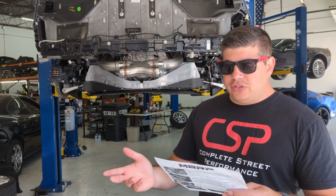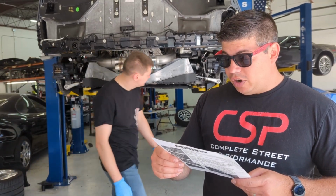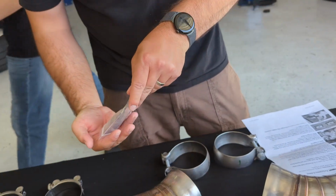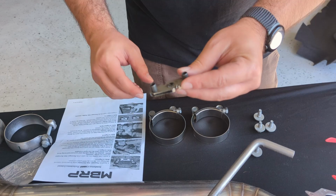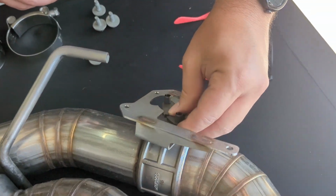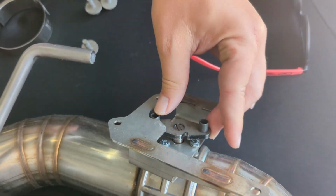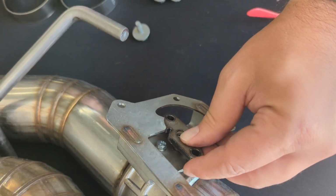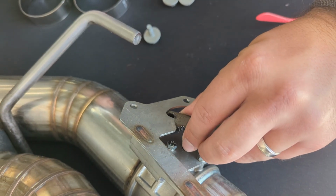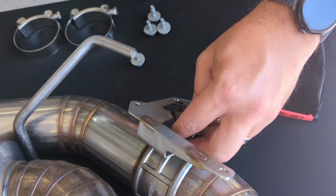So now that we got the clamps done, we're going to install the X pipe over here. Then install the spring pins into both driver hubs exactly as shown. This is for your dual mode function. So this one is very critical. They actually have you install this in a very specific way, because if you don't, you do not get the full travel of the system. It needs this to have the full travel. Otherwise, you end up being quite a bit short. You end up being at this point and only go from here to like there. If you do install it upside down, put it on the ground and hammer it through, it'll push the pins the complete opposite way. No, not the bracket yet.